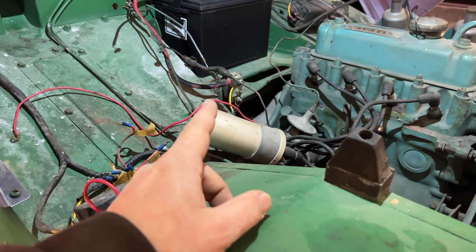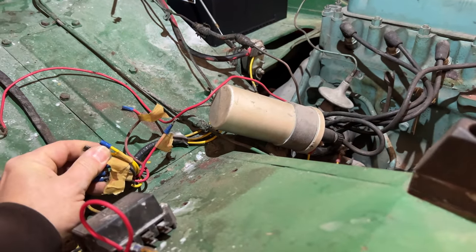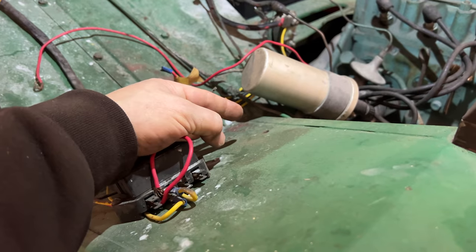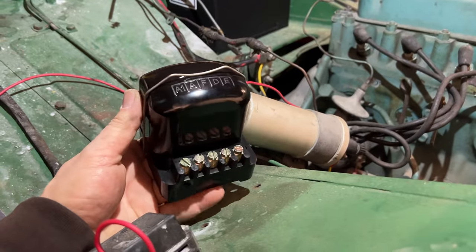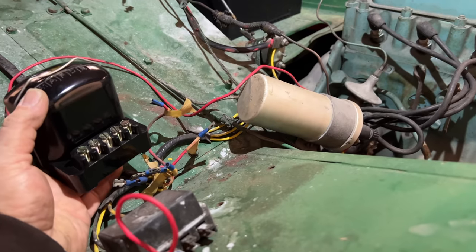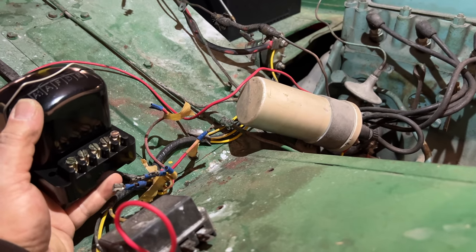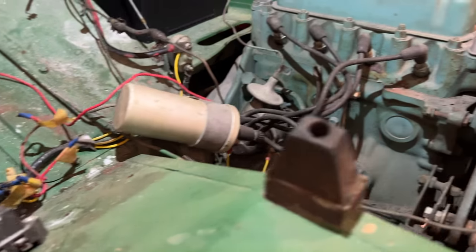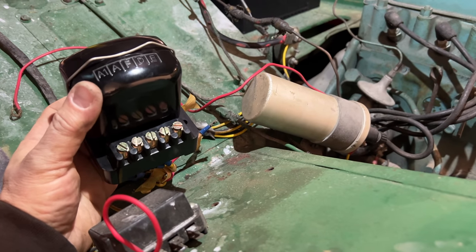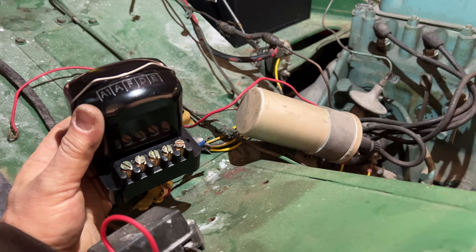Now that I have a way to start the engine, I need a way to turn the ignition coil on. This car has been outfitted with what looks like a homemade wire harness. This is the incorrect fuse box for a bug-eyed Sprite — what should be sitting right here is a regulator. I have a new voltage regulator here with five terminals. This wiring was probably connected to a voltage regulator, but currently the car has no generator or alternator at all. So I'm going to figure out which wires I need connected to the regulator to get the coil powered from the switch, and leave the others disconnected until I have a generator or alternator.